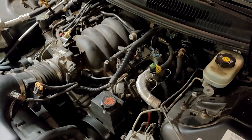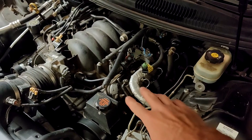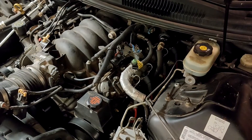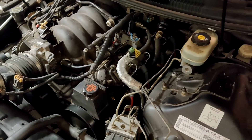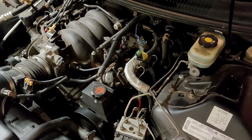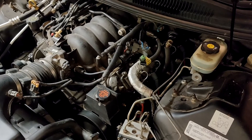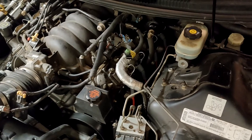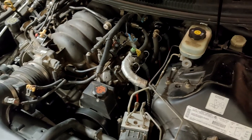It's all back together and running good. Just took it for a test drive. You can see the very light wisps of smoke coming off the exhaust manifold — where I had the anti-seize on the bolts and oil from my hands on the manifold. There was a sticker on the catalytic converter I didn't take off. So be prepared for odd smells if you do this — they'll burn off fairly shortly. Anyway, I hope this video helps you. Let me know if you have questions.